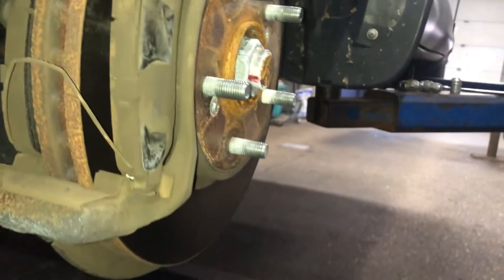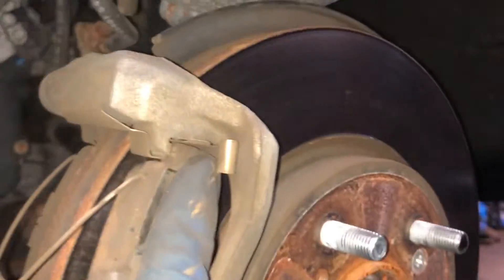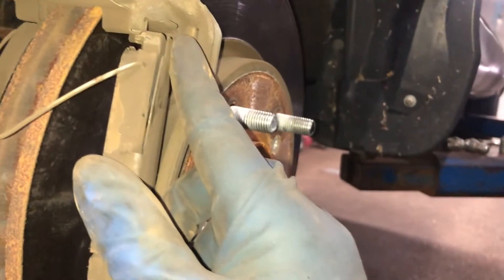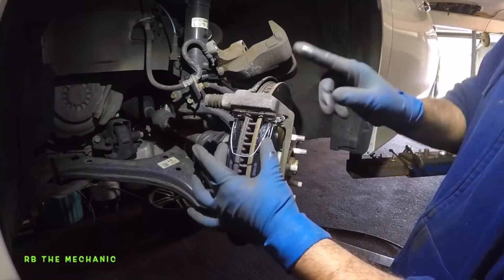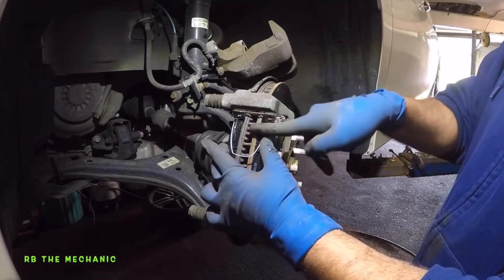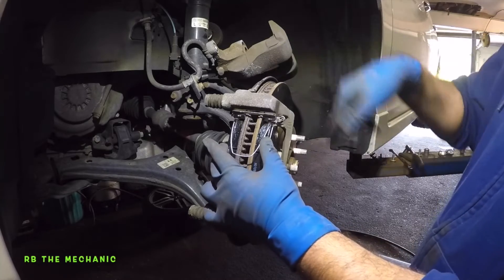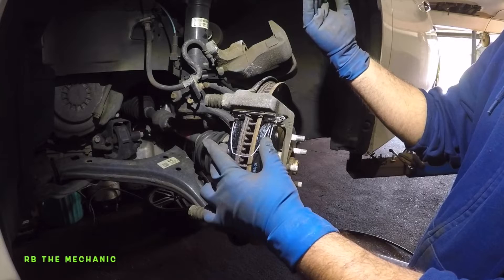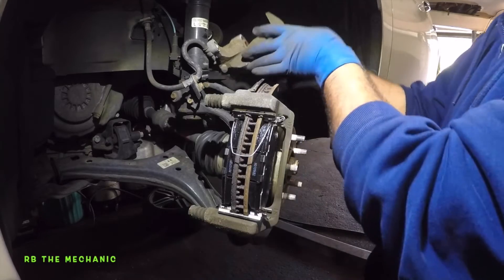It's simple, but it all depends on your installation — how the mechanic installed your brakes. If you didn't lubricate any of this stuff, your brakes are probably not gonna move around as much; they're probably gonna seize up and lock up on you. The reason you have to keep this open is because the rotor is going to try to turn inward as the car moves forward, so the brake rotor can slide right through easily.